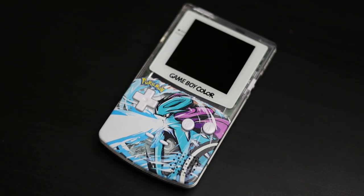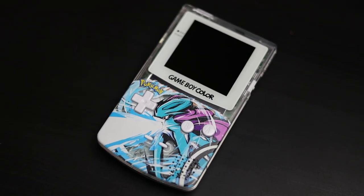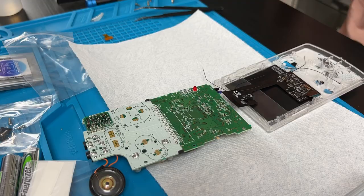Now we can get to the rest of the soldering. Here's where the community is kind of divided — it's me versus Natalie and probably everybody else. I like soldering to the test pads. One, it's easier than soldering to the vias. Two, I like the look of the wires showing, especially with a clear case. If it's opaque, it doesn't really matter. I'm going to solder to the test pads — it's a lot easier for first-timers. I will also show the via chart from Natalie herself if you want to solder to the vias. These wires are long enough to go to the test pads.